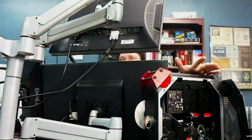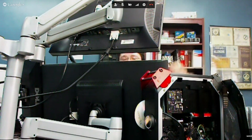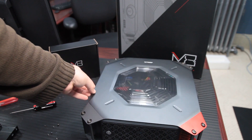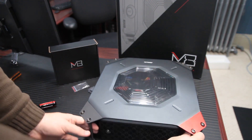I'm really happy with the build they put in here. If you're intimidated by building a computer, this would be a pretty good choice — you just buy this, get RAM, a processor, storage, and a video card, and you're done. You don't even really need a video card unless you want to play games at the highest settings. The Haswell onboard video can handle indie games and games from a couple of years ago. For a home theater machine with emulators, where when you put in a DVD it automatically rips and stores it — you don't need a video card. This is the perfect machine for that.